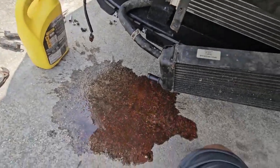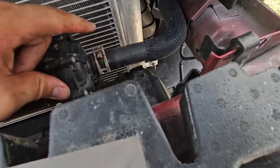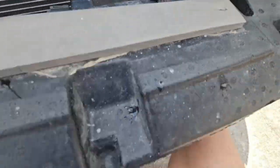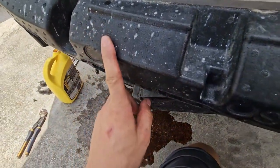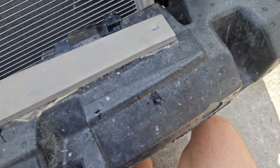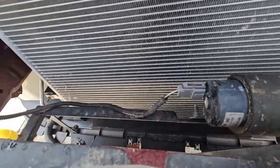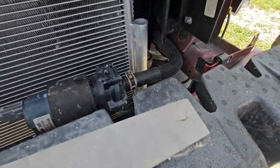I got most of the coolant in the jug without spilling — just a little puddle. You don't necessarily have to undo this front hose, but you may have to so you can get to the back one. That's the only thing holding the heat exchanger up at this point — just the back hose. You're going to have to take off this front bumper impact absorber to get to the 10s or 13s that hold the intercooler bracket on. You can see the two bolts, one on each side — take those off so you can drop the heat exchanger bracket.